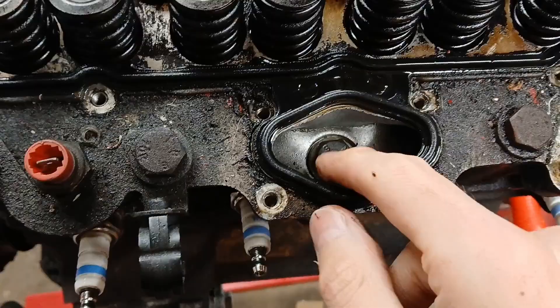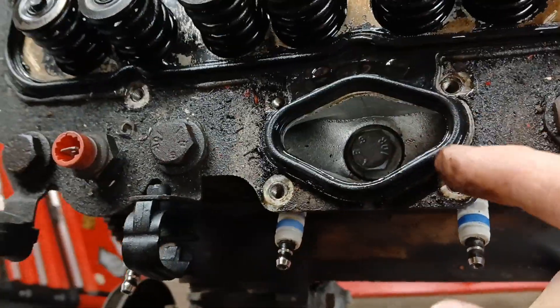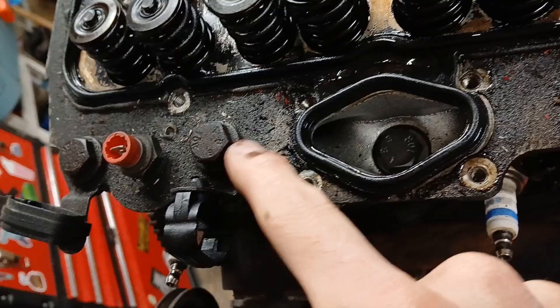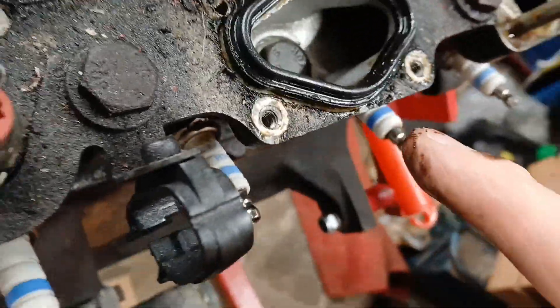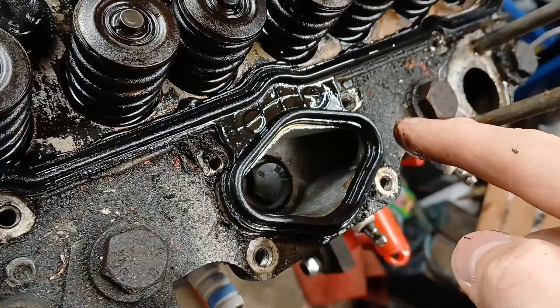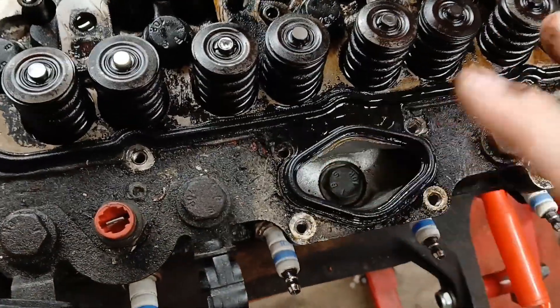Just while I'm here — this is what I was talking about. This is where the actual gasket seals, that's where all the inlet goes through. It goes around there like that, and all this piece in here will be the inlet for these two cylinders. And if you look down that one, it goes down there — that's the inlet for these two cylinders. This is why these don't really have a lot of scope to open this up and do all that kind of porting work.